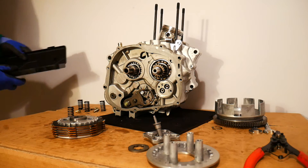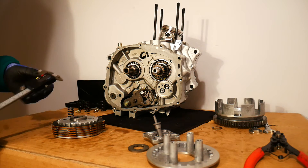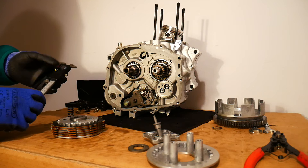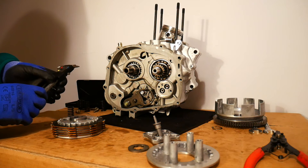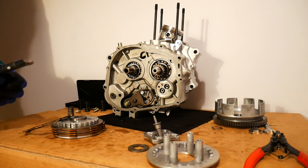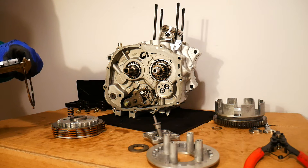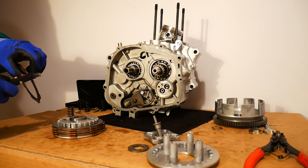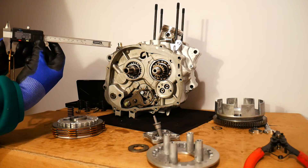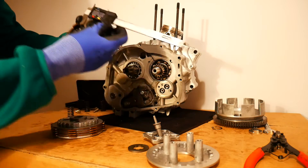To know for sure, you need to open up your bike, take off the clutch cover, take out the clutch pack, and use digital or vernier calipers for accurate measuring. You will need the service manual for your particular model of motorcycle. You can use the calipers to measure the thickness of the friction material — in this case it's three millimeters. You'll measure the thickness of each of the friction plates.